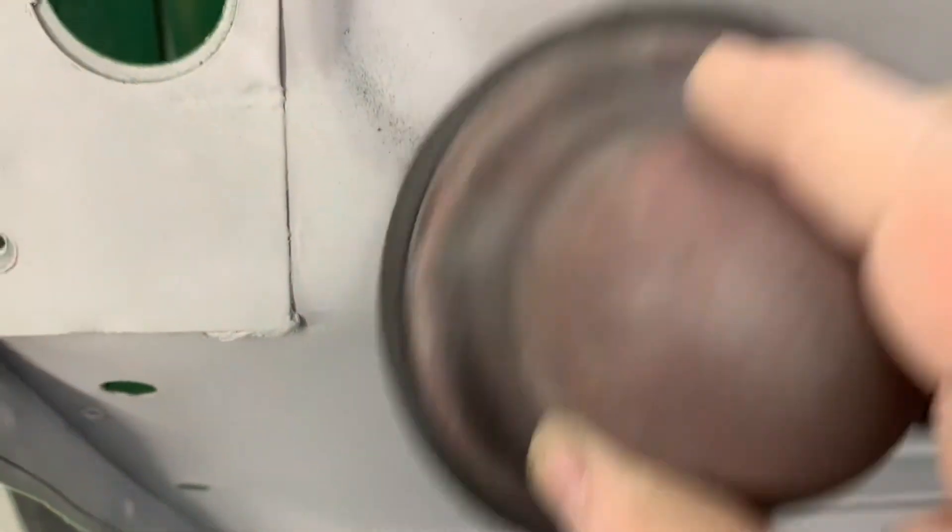What you're going to do — the object is to sand this completely off. If it doesn't sand off in an area, that's where you've got a problem. It'll get down deep in the cracks, pinholes that you missed doing body work, and so on.